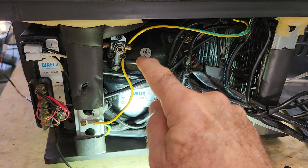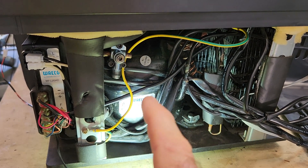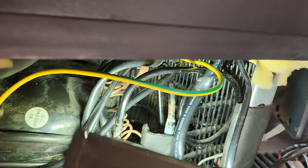What do I mean by that? The plate is much colder than the temperature inside the fridge. The fridge might be at 3, 4, or 5 degrees and the plate is at minus 12, so in relative terms the inside of the fridge is hot compared to the plate. The plate absorbs that heat into the refrigerant as it travels around, warming the refrigerant up and returning it to the compressor.